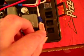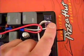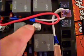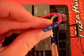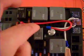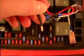Another wire with a spade terminal comes out the other end and goes into what would originally go to the door lock and window circuit. Then I took the other hot wire, put it into a female spade terminal, and put a 15-amp fuse in it. I ran a hot wire from there with another female spade terminal into the aux circuit, cutting a fuse in half, soldering that terminal on the end of the wire, and heat-shrinking it.